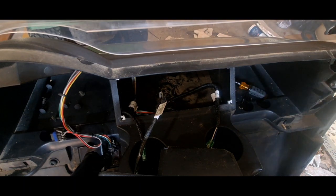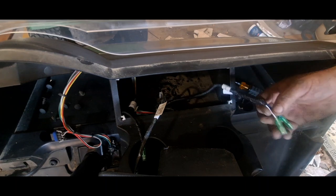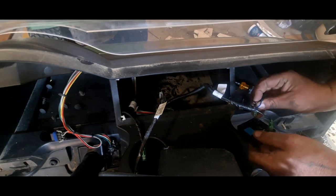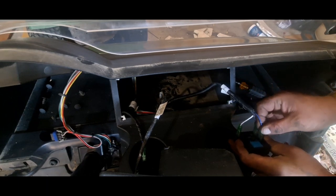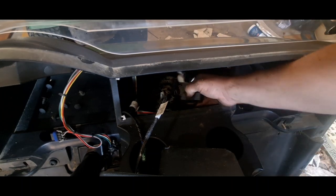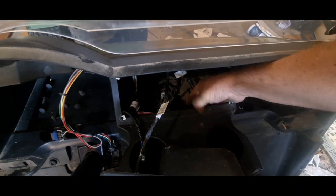It right out here. Says 1, 3, 2 plus, and I'm not sure. I would assume black is ground, negative. And so on the back of that headlight switch is red and blue, so I'm gonna say blue's the positive on this thing. Just gonna wipe off a little spot right there in the back of that. If it's wrong, she's wrong. She just plugged in right there.